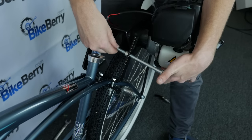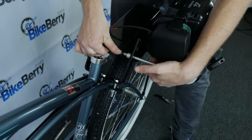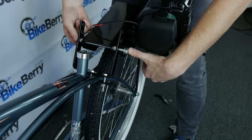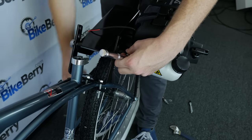Next, we'll mount the engine onto the mounting plates. This part is much easier with two people, but it's possible with one person. Put the engine in place like so, then drive the bolt through. Be sure to put a spacer between the mounting plates and the main mount for the engine. Then use two wrenches to tighten the end nut.